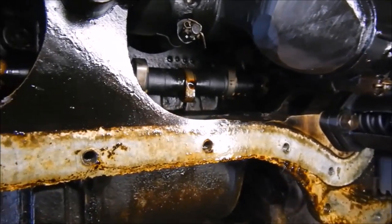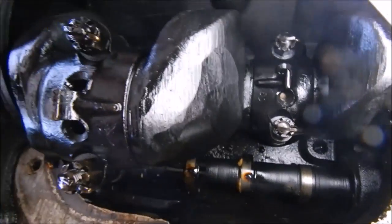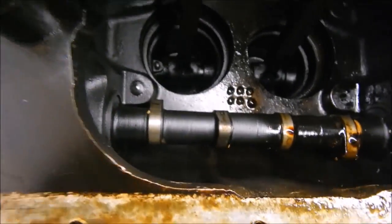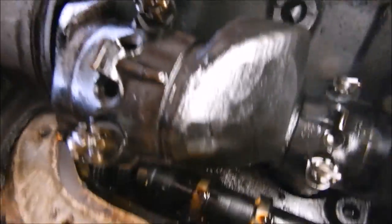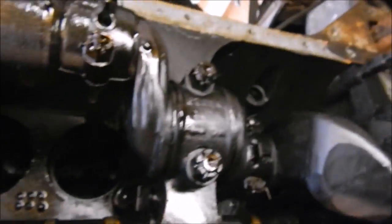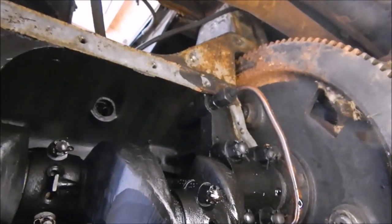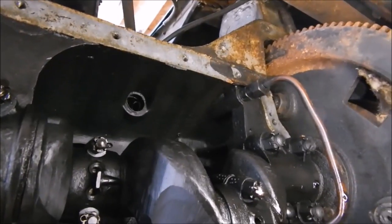I can't really tell if the camshaft looks worn down, but I don't think it really is — I know this car was put into the barn 80 years ago because the steering went out, hit a rock or something. The camshaft pushes the push rods up and down, which are on the outside of the engine. And there's the shaft that comes down that turns the oil pump. Here's the oil pump, and there's that copper pipe that goes up to the dashboard — that's the tube that pushes oil up to the dashboard sight glass.